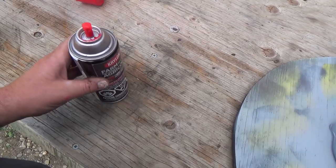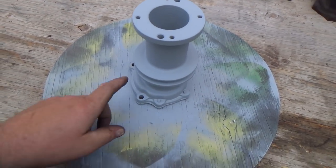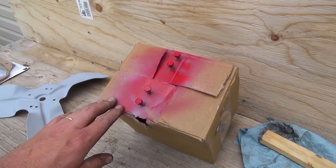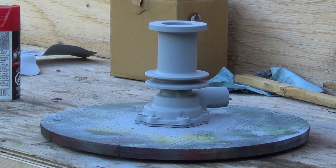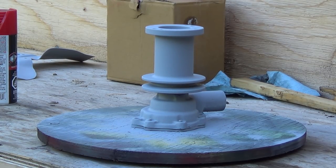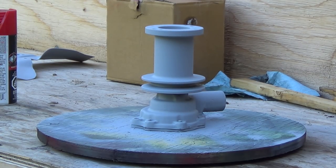Some of the other spray nozzles are really crap — they clog up a lot, just junk. So anyway, we will get the red going. I got that red and another one here because we're probably going to need it. This is Krylon farm implement paint — Massey Ferguson red. It's really close to the red on the tractor, so that's what I go with, that's what I painted everything else with. With this one you want to go light coats. It goes on kind of pink, and then the next coat will be more red.